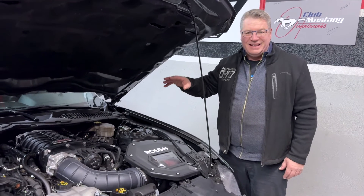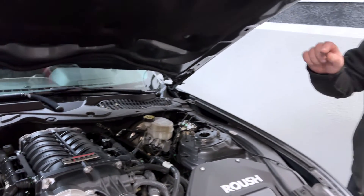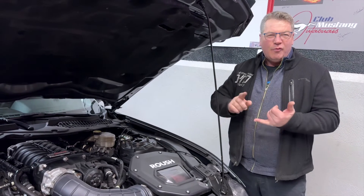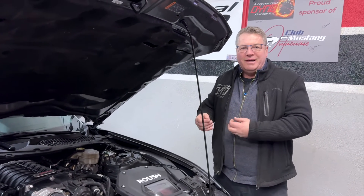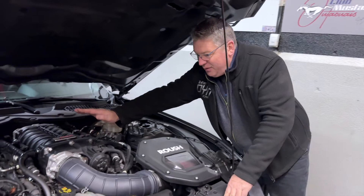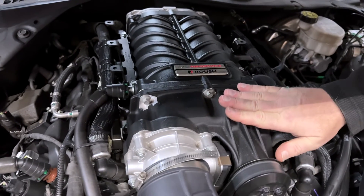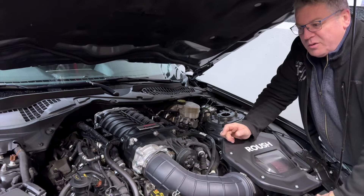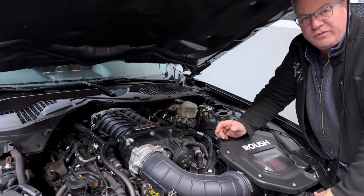This is the Roush performance kit that gets bolted onto the five-liter Mustang. The five-liter Mustang engine is already extremely stout — it already has 12.5 to one compression. So when you put a couple pounds of boost onto an engine that already has 12.5 to one compression and four overhead variable cams, you get a really stout package. There's literally nothing else on the market today with that kind of performance that you can just bolt on a supercharger and go. This is a TVS 2650 — Roush and Ford rebadged it, but it's a TVS blower, really, really good unit. It pushes the air in, pushes it around, pushes it down into the intake, and makes pressure on the intake. This should make about 11 pounds of boost, which should bring us up to over 750 horsepower.